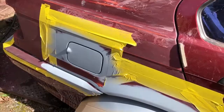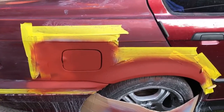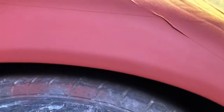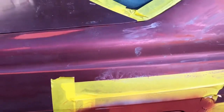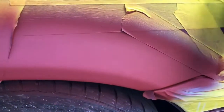Alright, let's have a look. I have the red primer on now and it's come out quite nice and smooth. I am happy with that. I will give it a very, very fine sand down with maybe a 1500 just to make it as smooth as possible, and also 1500 everything else quickly to make sure it's all nice and free from any dust.